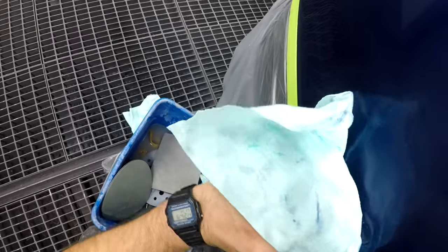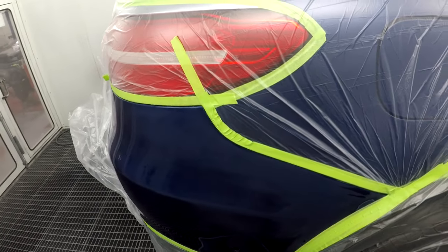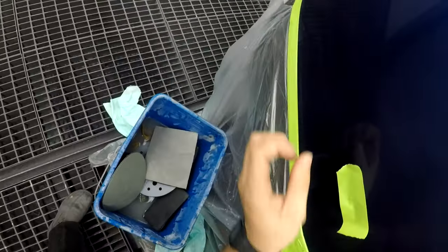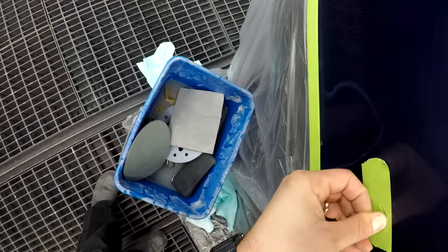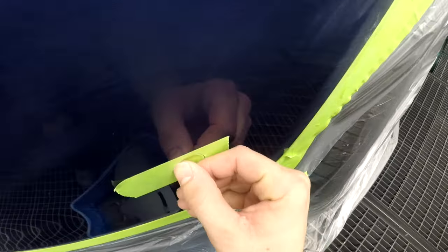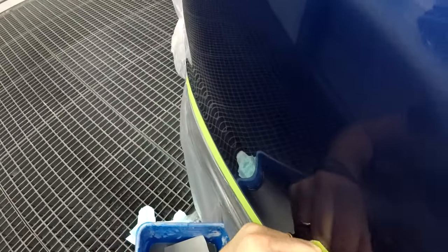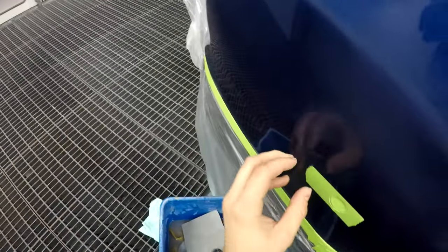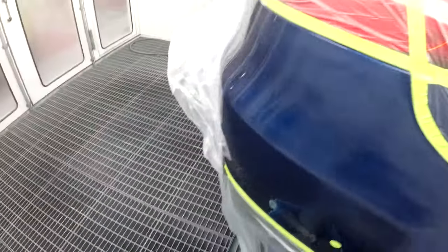For this sensor, I'm going to mask it because there won't be a lot of material down there — it's only going to be clear. The way I like to mask this — I don't know if you guys have seen this tape tool — it's amazing. I love this tool. It's been around a long time but I never had it until now. You just put it on there like that, and then with my nail I'll cut it out. If you don't have big nails you can just razor blade it, but I find it easier with my nail because you can round it off better. There you go — not bad. Just like that. Beautiful — a nice clean cut.